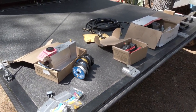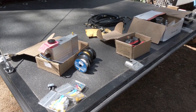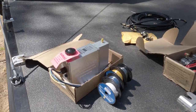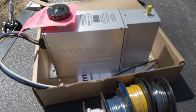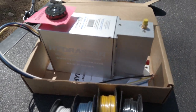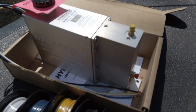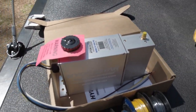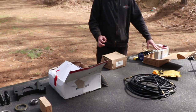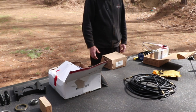I've laid all of the components, tools, and stuff that I'm going to need out on the rear deck of the trailer. The heart of the system is the electric hydraulic pump, and what this does is convert the brake signal from your truck into hydraulic pressure to run the brakes. Whereas with electric brakes the more you apply your brake pedal the higher the voltage on the brake signal going to the trailer, here that higher voltage makes the pump drive higher pressure, which in turn applies the brakes more firmly.